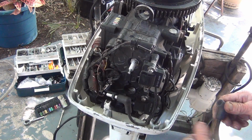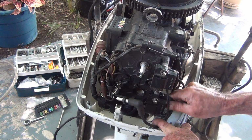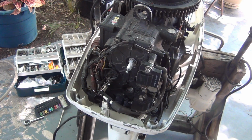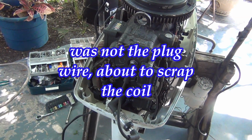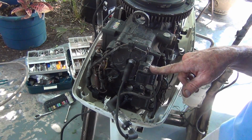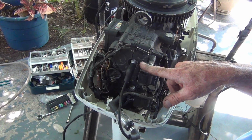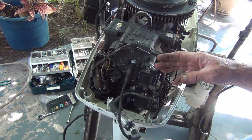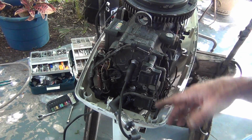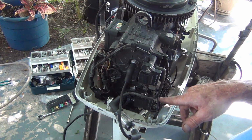Alright, swap this plug wire, see if I get a spark on the top coil. A little swap-a-rooney here. Alright, let me try that wire. This way we'll eliminate this wire if that's all it is. Alright, before I totally eliminated this coil, I tightened down my ground wires. Flipped it around again, and I still couldn't see anything. But it sounded like I could hear it, but I couldn't see it like I did when it was a little slower with the other battery on the bottom coil.